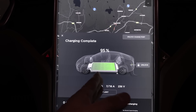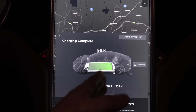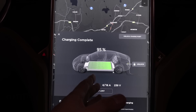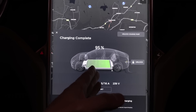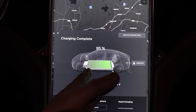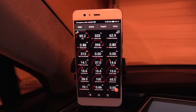I've been doing a discharge cycle to one percent and then slowly charging it up to 100, but it didn't go to 100 last night - it stopped at 98, and this is what we are trying to fix. When the car stops at 98 or 97, it doesn't mean that is degradation. It means the battery has not been calibrated. Even a battery that has degraded 10-15 percent should charge to 100 percent.